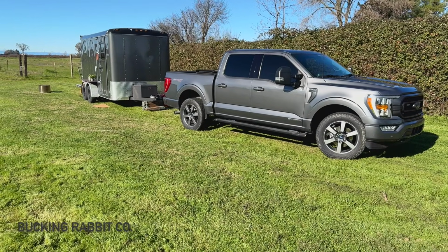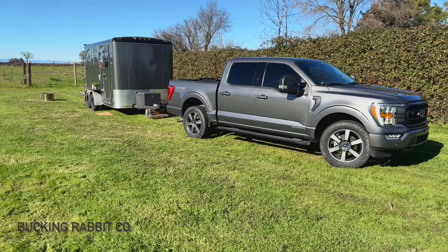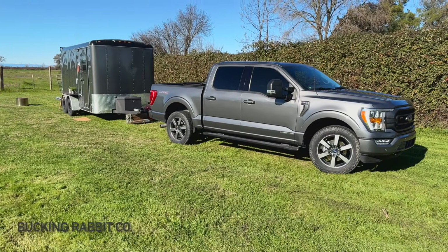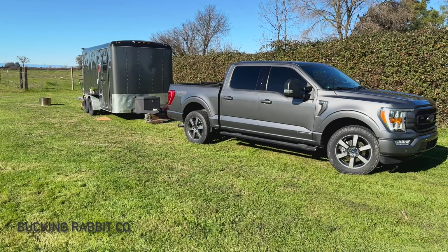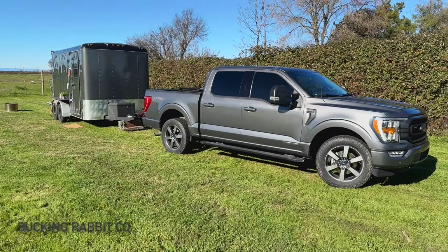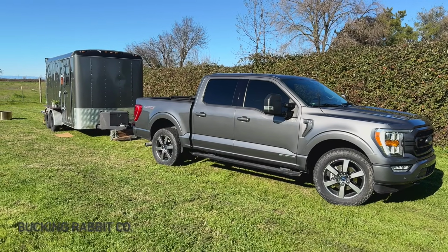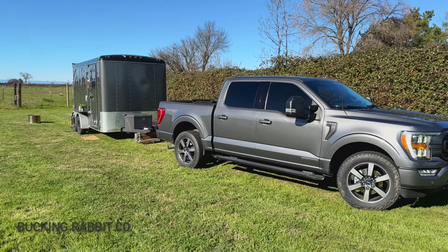So they have 2-hour blocks, 3 blocks a day. With the truck, you have power pretty much the entire time you're there. Our use case, the truck self-regulates, so it turns on about every 2 hours and it'll idle for about 90 seconds to recharge the hybrid battery, and that's it. So we have constant power at camp, and we don't have to follow those generator restrictions, because when the truck does start, it's just an idling vehicle. And those really aren't that loud, especially when you have newer vehicles. So fantastic use case for that.